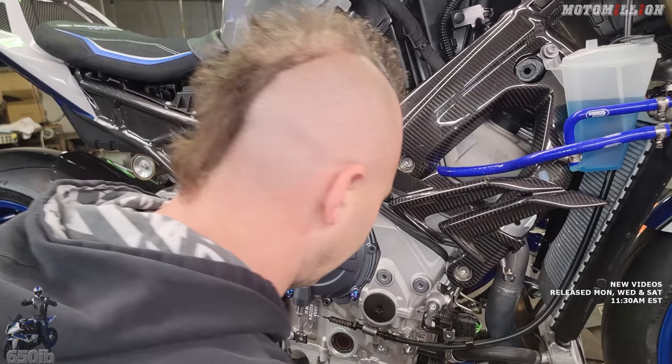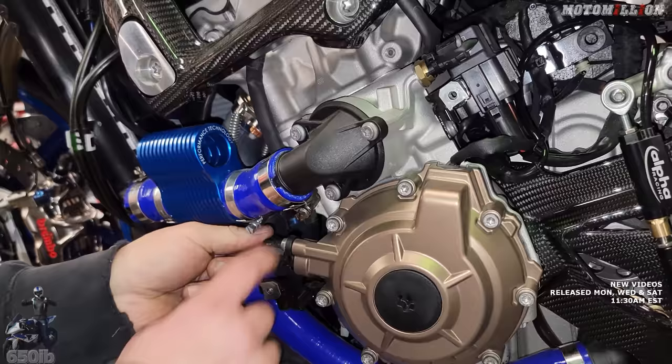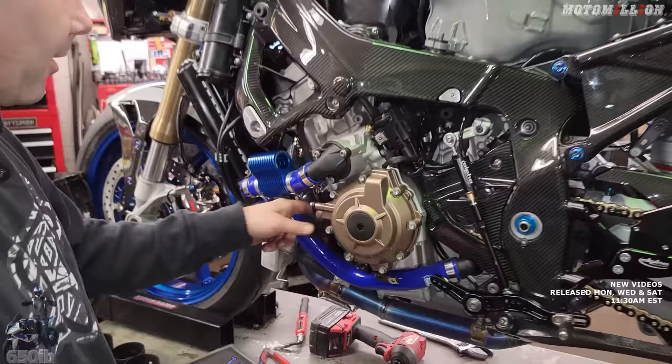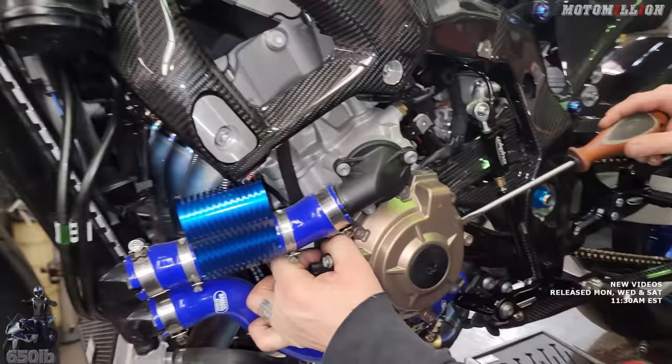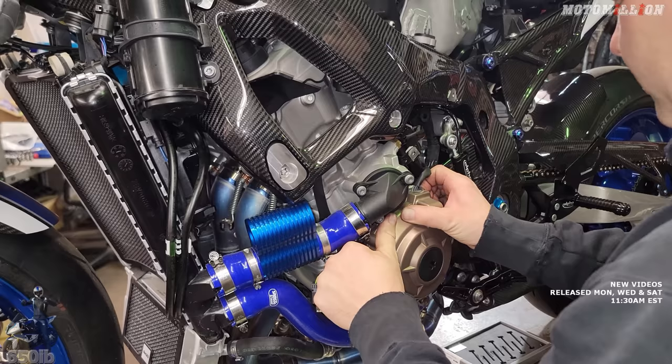We've got to disconnect our crankshaft position sensor to do that — this is a two-position clicking type connector. So we pull that out, then push back and this outer part slides over like that. Now we push on this extra hard and you can hear it click, and now the whole thing will release — you have to do that in two steps, otherwise you could break it. We're going to move this sensor over to the new cover as well. Also on the inside of this is the stator and a little bit of oil, so I'm going to grab a drip pan. This is going to be a little tricky to get off — we've got the magnetism between the stator and the rotor, and it uses sealant instead of a gasket. Once we break the seal it will come off, but be careful if you get your fingers in behind there because it'll try to suck it back on — it's a giant magnet.